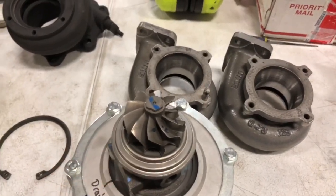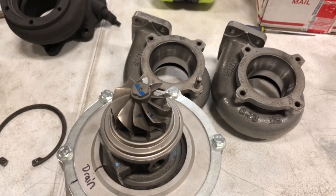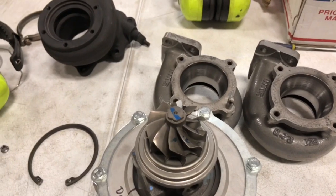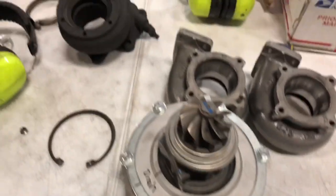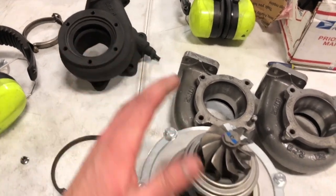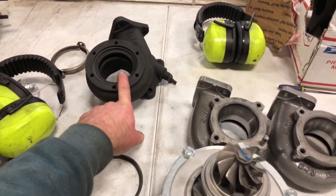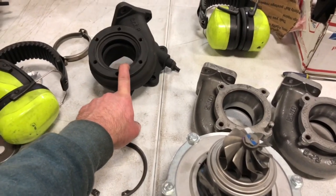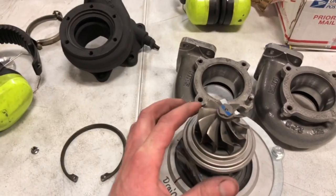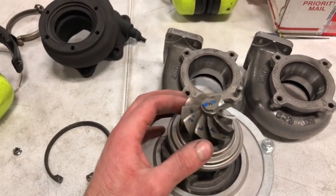This turbine is used in other different turbo variations, but this is one I've seen more commonly. The other would be some of the Blouch turbos — I think this is a Dominator 2 or Dominator 3 — and this turbine fits directly in the turbine housing from Blouch. That one had a GT3071R compressor wheel and then this 53.6mm turbine in it.